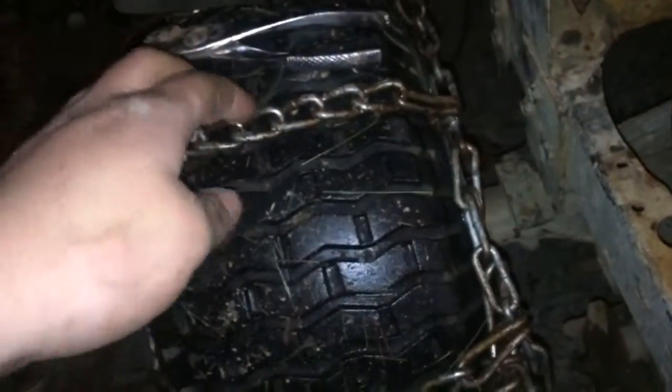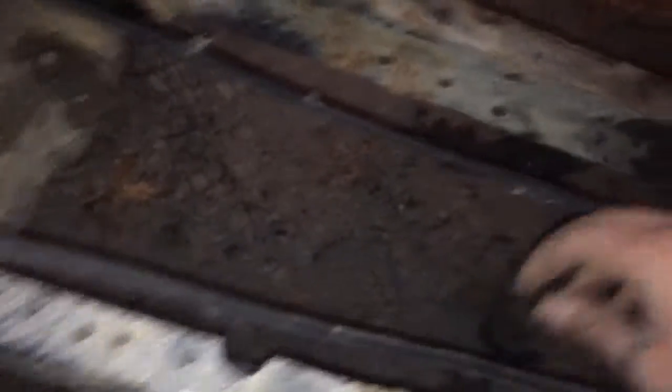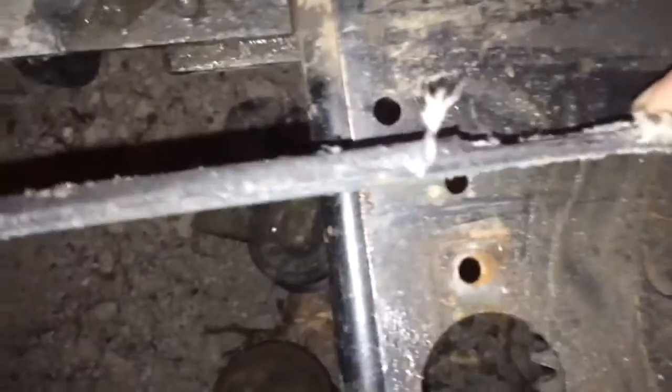This Murray is a lot more useful than that racing mower because it's got normal tires. I put chains on them and you can drive it through the mud, winter snow — it hauls like crazy. One thing I got to do though is figure out why the belt always comes off. Even after I had all those tensioner pulleys it still had a ton of room. Definitely got to get a new belt — this one is shot, just shredded.